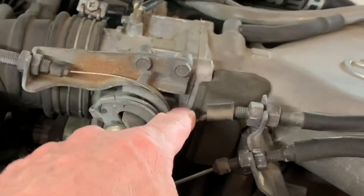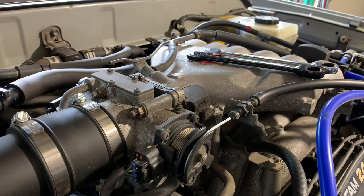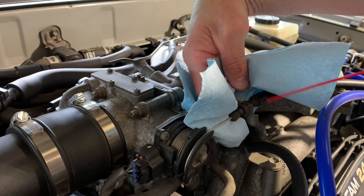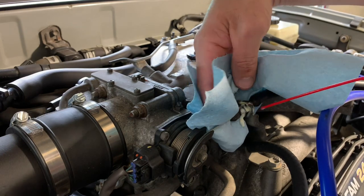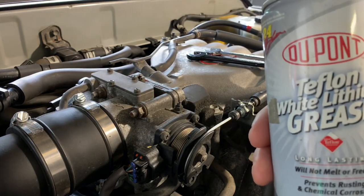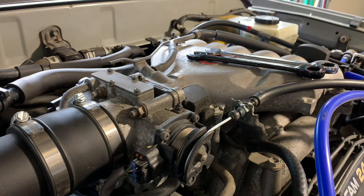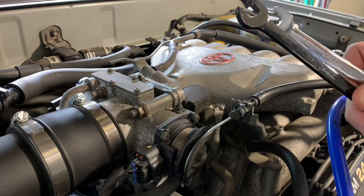That's really loose. To prevent breaking off the bolt, we're going to take some white lithium grease. Maybe some of these bolts are a little bit seized up — you could probably use WD-40, I just chose this because it was on the shelf. Let that penetrate a little bit, then we'll use two 14-millimeter wrenches.